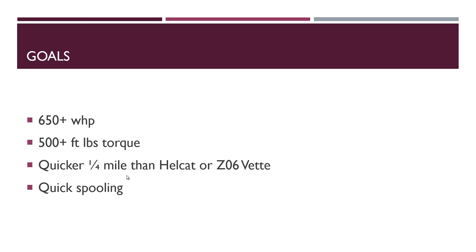My goal is to have 650 horsepower at the wheels. Whatever torque comes along with that is fine — I fully expect it'll be well over 500 foot-pounds. There are several Hellcats and Z06s in my vicinity, and I want to smoke them all. I think it'd be hilarious to have a little 123 scream by these cars and give them no chance. I also want this thing to spool very fast. Right now the car is quick with just the HX40 Super running at 40 pounds — I want to stress it's not an eBay HX40. Once it kicks in it goes very good, but it is very slow to spool, so I'm hoping the end result will be a setup that spools much faster.